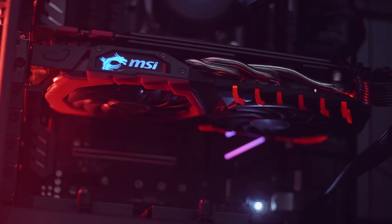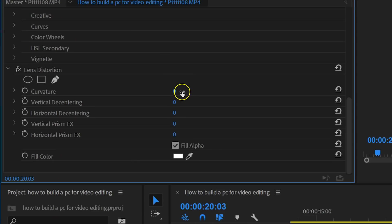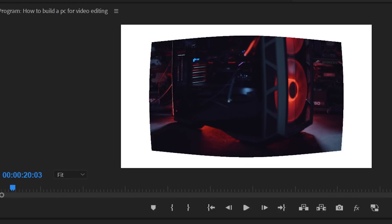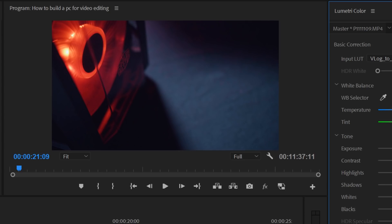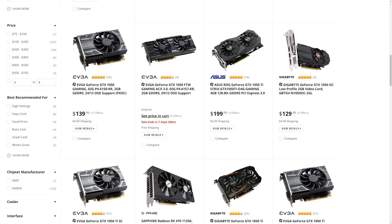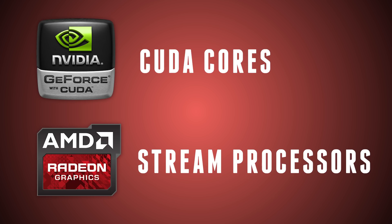Next on the list is the graphics card. Modern editing software is able to utilize graphics cards more and better these days, but it's still a fraction of what the GPU is capable of. In Premiere Pro you can actually see a symbol next to effects that can be accelerated through the graphics card, meaning you can apply and even stack effects on a clip for real-time playback. The same goes for color grading inside Premiere, but all the rest of the effects will use 100% of the processor to render. When searching for a graphics card, one of the first things you'll notice is the memory it comes with — don't mind this too much for video editing. Video memory is needed for animations and 3D modeling; I wouldn't spend extra money on just more VRAM. What is important is the amount of cores in your graphics card. Nvidia calls these CUDA cores and AMD Radeon cards have stream processors — essentially the same but built on different technology. AMD cards use OpenCL and Nvidia have their own CUDA technology.